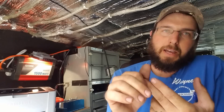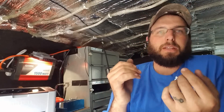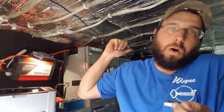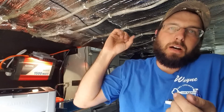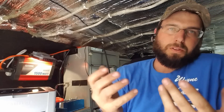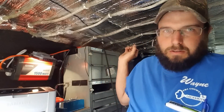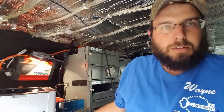The way I have mine set up is I have a wire that comes from the battery right at the connection. It then has three fuses — I've got 60 amp fuses in them right now, and that's going to be more than they'll ever use. That wire trickle powers everything and brings the power to charge the battery.